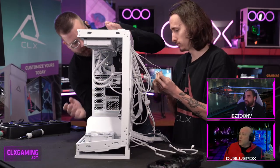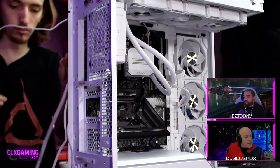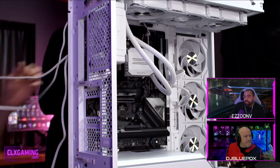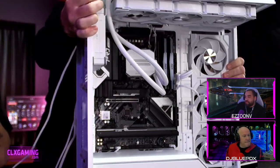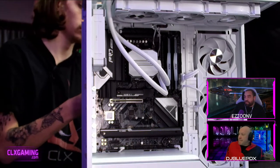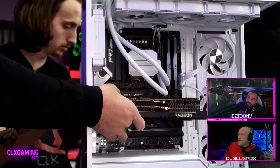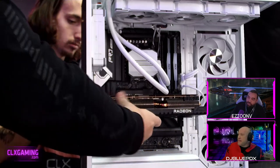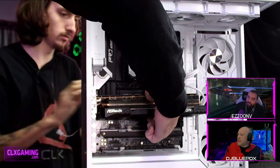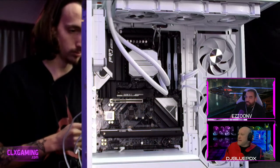So on this one, it kind of depends on your motherboard layout. But for this specific build, we're using a 2-slot card. That's probably about a 2.5 slot with the way the fans stick out a little bit. But with the layout, we will have our two PCIe x1 slots open up. So I'll just throw this in while we're at this shot to give you guys an idea. This card's going to sit in our top slot there. Try to get my hand out of the way. And then you can see these two PCIe x1 slots right under it that we'll have open. If this was a giant card, it might be covering that PCIe x1, but with the size of this card, they're both going to be available.